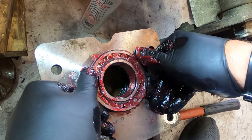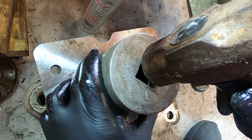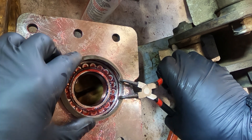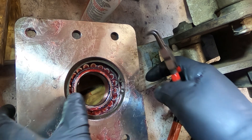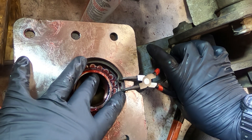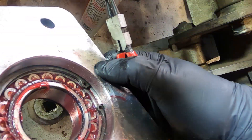Let me get these bearings lined up. It's important to go in smooth and even — get it started even. I just use that socket and start slow. Now we've got to get the snap ring in there. I would recommend a bigger set of snap ring pliers because these are a little difficult. You just got to get it started and work it down — you'll know it, it'll click into the groove. I'd get some bigger snap ring pliers if I had to do this over. There it is — it's snapped in. You can see it, it's all the way around in the groove.